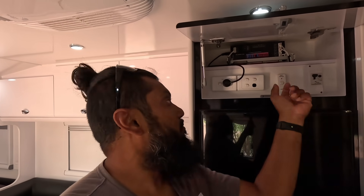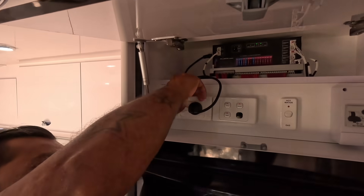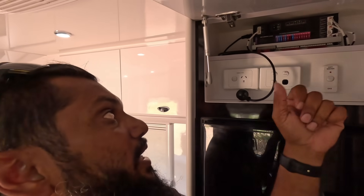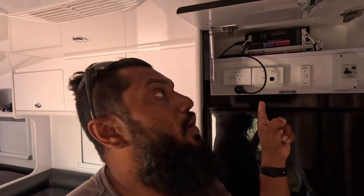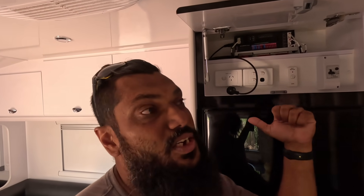Before we get started, we're going to isolate that battery. Even though I'm not on 240V, I'm still going to turn the power off there and unplug my charger. There's actually no way to isolate the solar in my caravan, which is a bit of a bummer, so I'm just going to turn the battery charger off itself. The lights have gone off and that should isolate all the wiring between the battery and the charger, meaning there's going to be no charge going to the battery — now it's safe to disconnect.